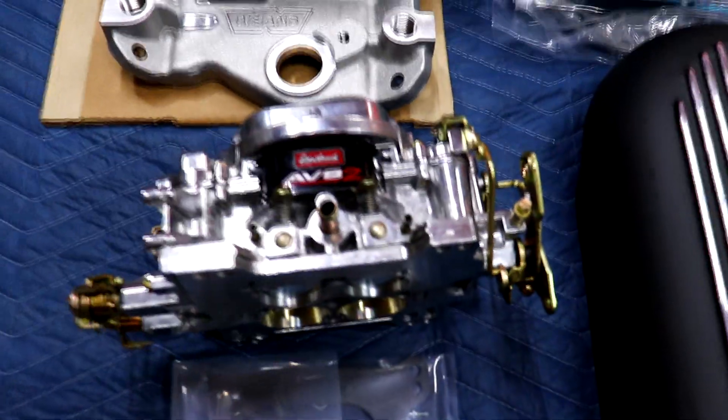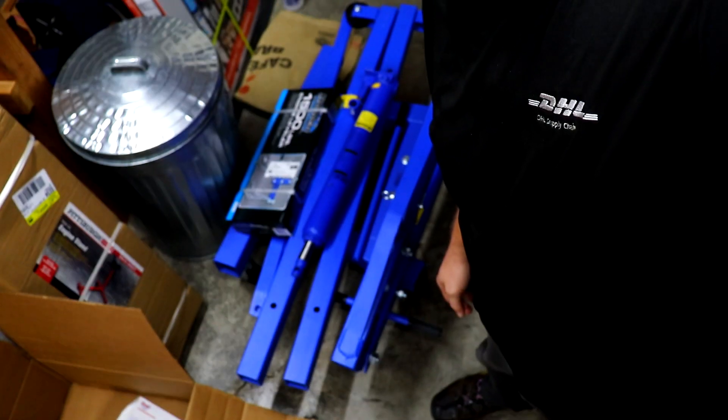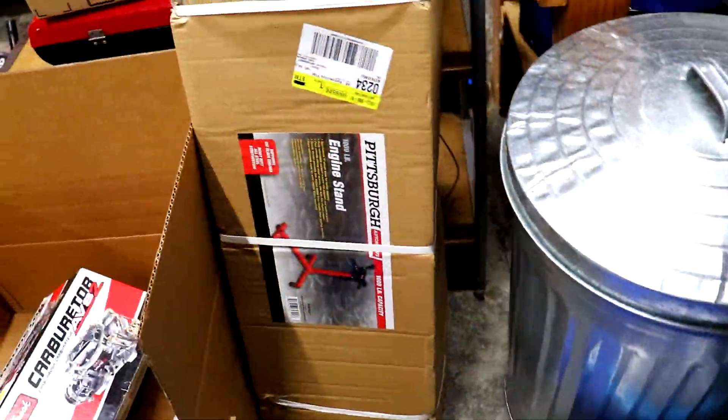The next video, I'm going to be installing this carburetor, installing the distributor, and putting the fuel system together. I want to make sure all those things are in working order before the blower goes on, so I don't have to worry about whether there's something wrong with the carburetor, ignition, or fuel system. Also, as a preemptive measure, I went and bought a shop crane so that when the engine needs to come out it can, and an engine stand so I can put the pistons, rods, and crank back in when they get scattered all over the pavement.